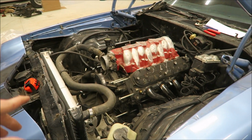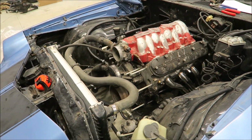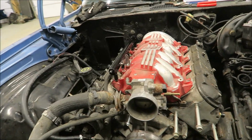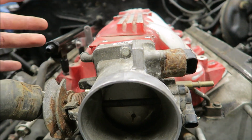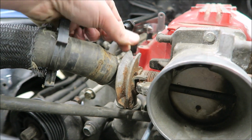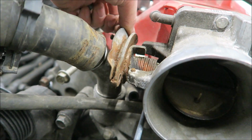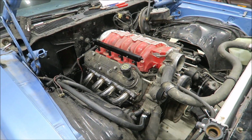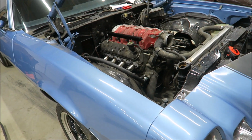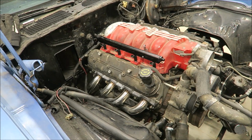All right, so this one doesn't fit perfectly because of the steam ports off the heads and stuff, but you can get a pretty good idea. And you can see what I was talking about the other day with an LS1 style intake, which this is real similar to dimensionally. An LS1 style intake working with the truck water pump, you just have to cut this little cruise control bracket off and it would fit. Right through there, it works fine. And it would clear if that weren't there. But this thing just made a big difference in terms of looking like a car. This thing looks way closer now.